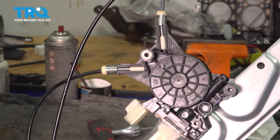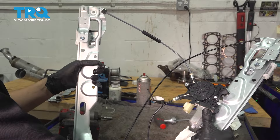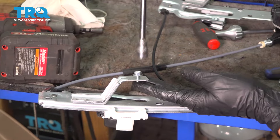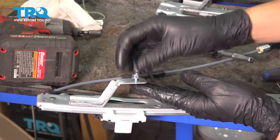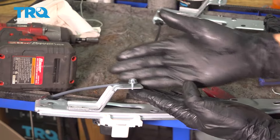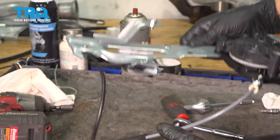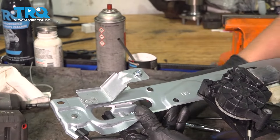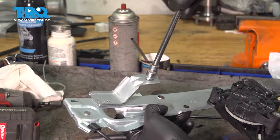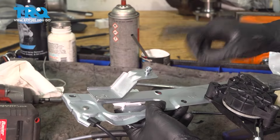Just as a side note, the gray cable should sit on top going from the right-hand side to the left-hand side rail. On the new regulator, let's back off these 10mm bolts for the top here. The reason for that is so that we can actually slide it into the door — it's slotted with a wider hole and then a narrower part at the bottom, so you basically hook it in and latch it. This will hold the top of the regulator as you try to line up the rest of it.